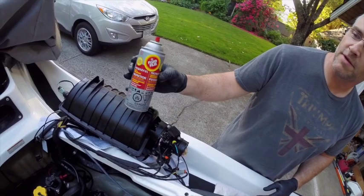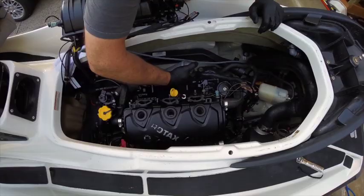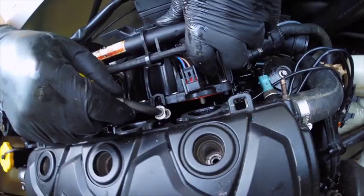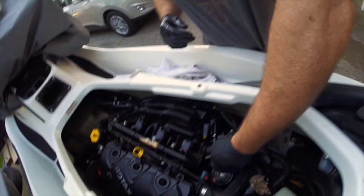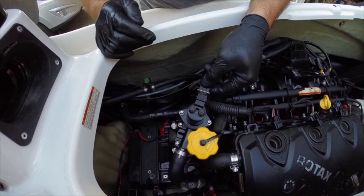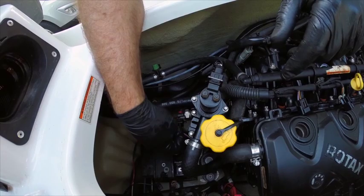Get this main coolant line hooked up to the fitting on the underneath, right underneath here on the manifold. Chris has gone ahead and put on that coolant line. We're going to use some fluid film — it's kind of a waxy anti-corrosion product. Plugging in the connector for the oil sensor before we get carried away with the manifold. Torquing it down now — 89 inch pounds according to the manual. Reconnecting the electrical connectors we disconnected to get the manifold off, including the oil pressure switch.